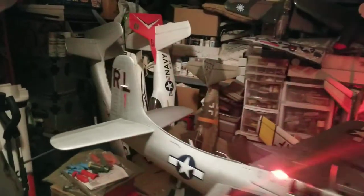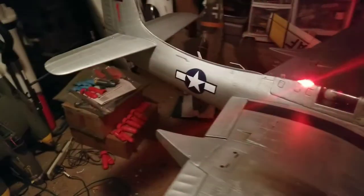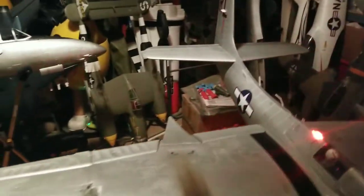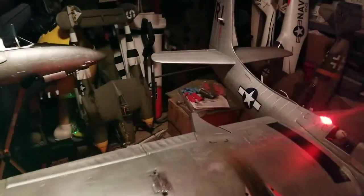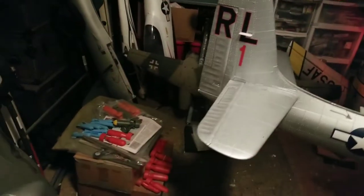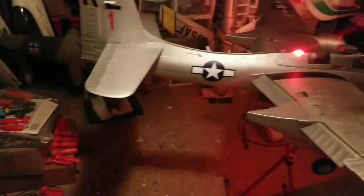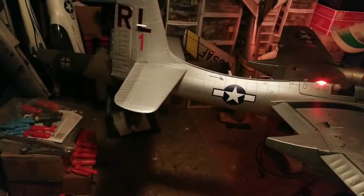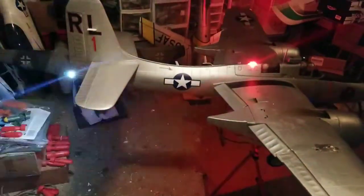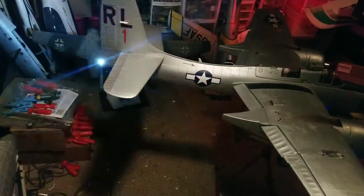You'll notice there's one here on the tail too. That's not active, but it comes on when I drop the flaps — so it's kind of like an indicator that when I drop the flaps, that strobe comes on. These are all one-watt Cree lights that I have on here, wired through a Dimension Engineering control board.